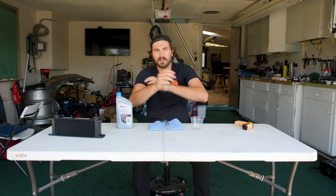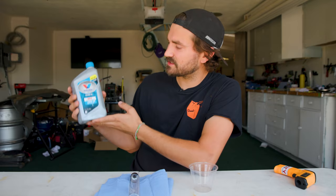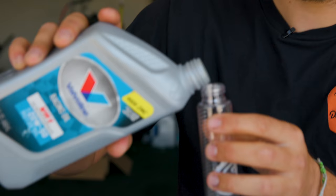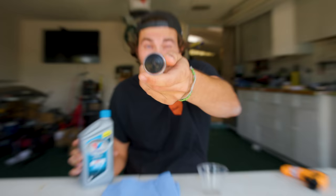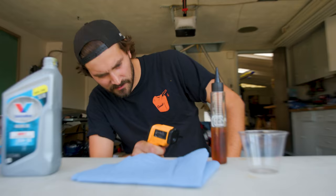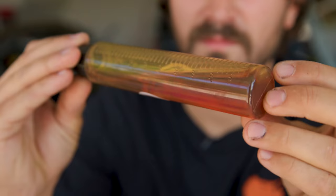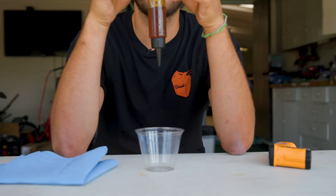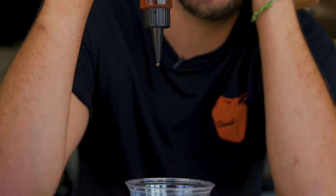Before we get into it, let's get a grip on what we're really doing. Engine oil, like most fluids, gets thinner as it heats up. To demonstrate that, I've got a very scientific experiment lined up. I've got this Valvoline VR1 20-50 — this is what I run in the RB, and I had it in the freezer so it's pretty cold. We're going to put it in this little dropper and see how quickly it passes through that tiny hole. Then we'll do the same thing with the same oil at a much higher temperature. It's 60 degrees, been in the freezer for about 20 minutes. It's cold enough that you can see how slowly it flows. This is 20-50, so it might take a while. I'm not squeezing it — just letting it drip how it wants to drip.